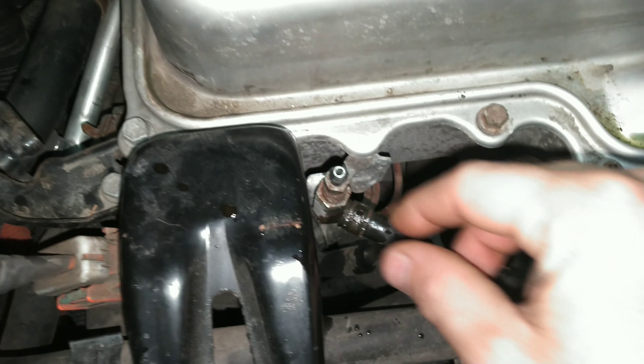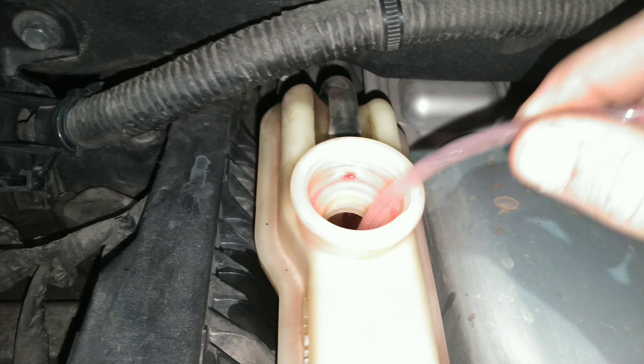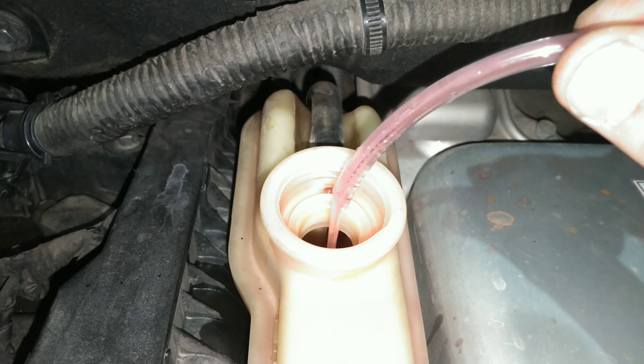Now you're going to connect the hose to this to bleed the air. Take the skinny hose and squeeze it onto the end of the bleed valve. If you get the one fourth inch inner diameter, it should be a perfect fit — it's a little work to get on there but it's nice and snug. Take the other end and stick it in the coolant reservoir, then unscrew the bleed valve a little bit by hand. Watch how the coolant comes out the tube — the coolant is running through, and those air splatters are air bubbles being purged from the cooling system.